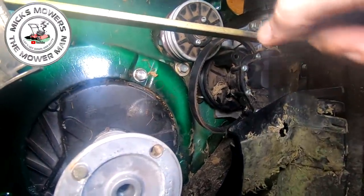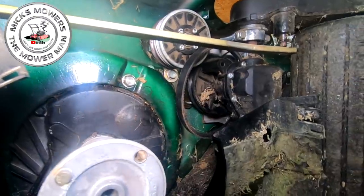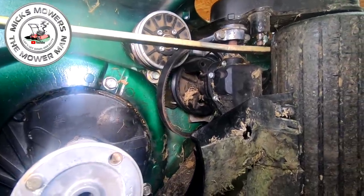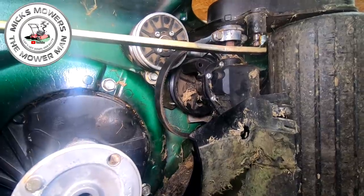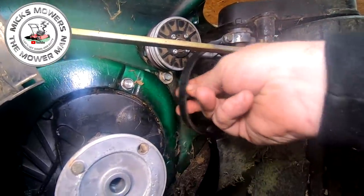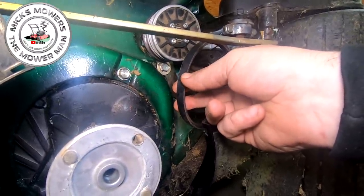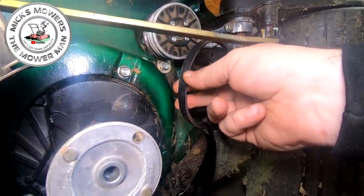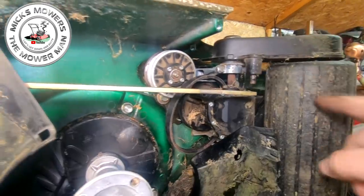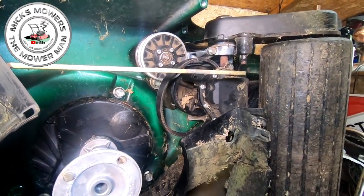It may also pay to give that variator a little bit of an oil up whilst it's out, and just make sure it all moves as it should do. A bit of an oil up, a bit of a clean up, an air blow and what have you, because you don't want to have to come back and find out your suspension's working, but your variator doesn't. And half the reason these variator drives pack up is because you lose up to about 3 millimeters of wear on this belt, and I have commonly seen that lawnmower repair shops do not change this belt. They change this one, but don't change that one, because they know all of this has got to come out. But there you go. So let me put the belt on and I'll come back to you once I've done the variator up as well.